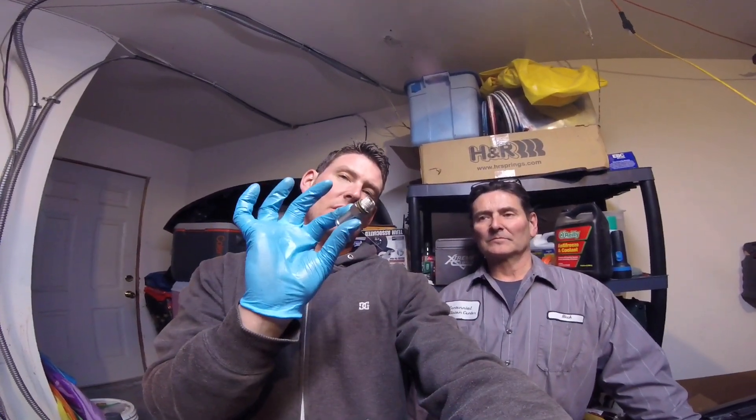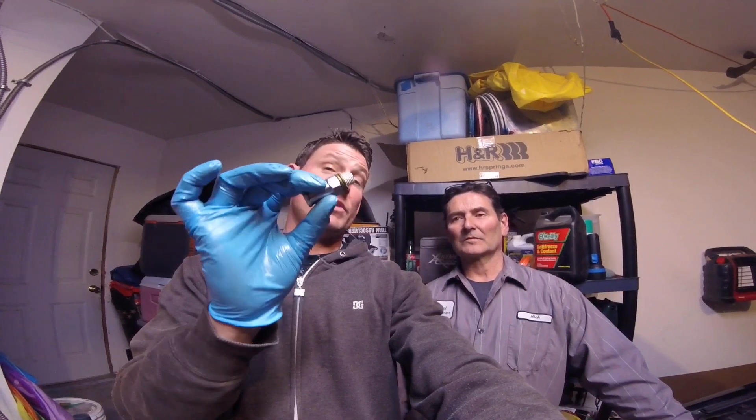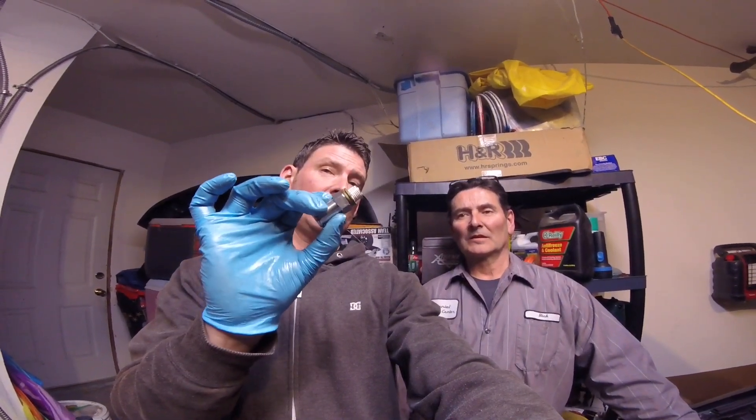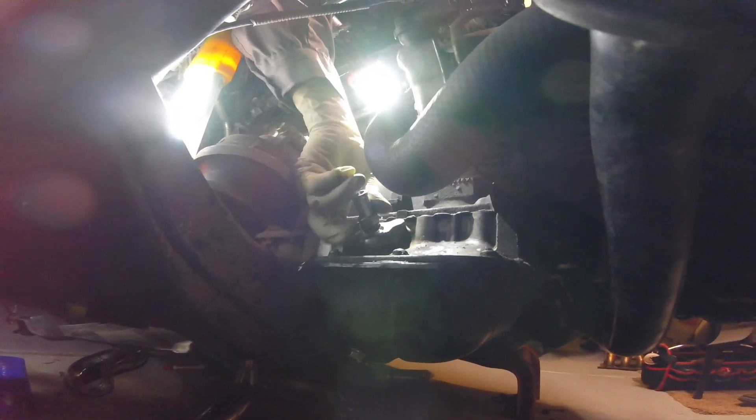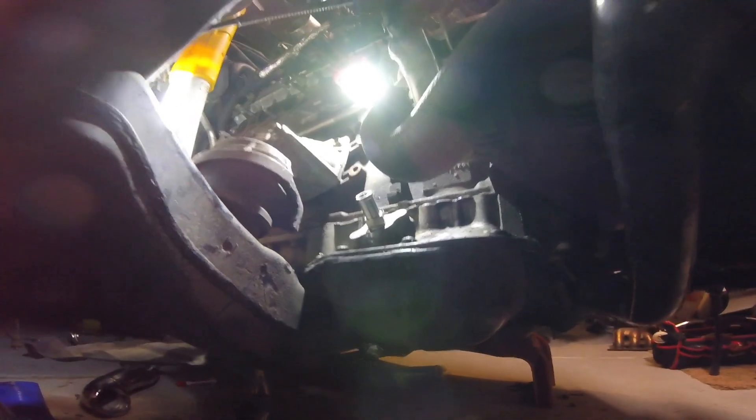Once that all gets in and cures, we've flushed the hole very, very well with some fluid as well as some brake cleaner, and I'm going to flush the oil as well. So let's go ahead and thread this thing in. Got to be really careful tightening these up because you only have about 3/16ths thickness in there, if that — and it's just aluminum, so got to be very, very careful. A nice taut fit. Once that thread sealant cures, it'll really help hold everything.